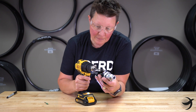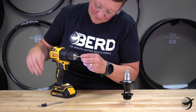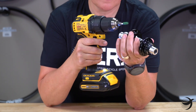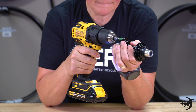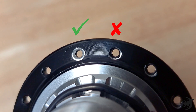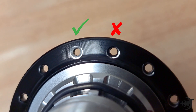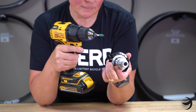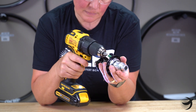Once the sharp corners have been removed, use a green polishing bit in a power drill or rotary tool to polish each prepped spoke hole until it's perfectly smooth. When done correctly, this hub prep procedure leaves a continuous smooth surface uniformly around the spoke hole. If sharp corners can still be seen, continue the prep procedure until you've achieved the desired results.